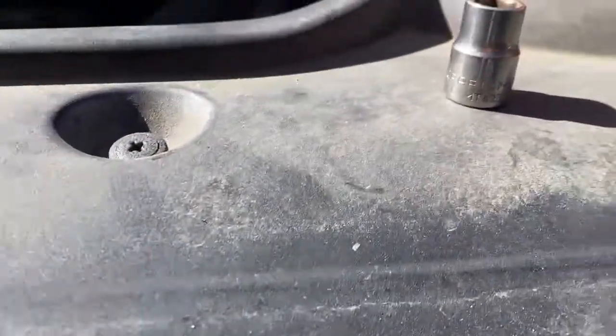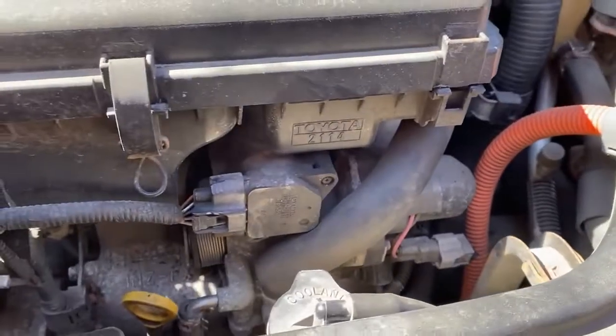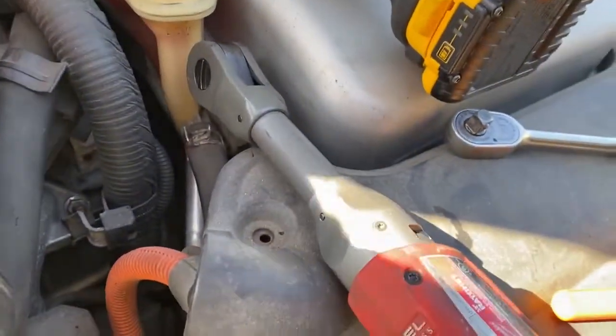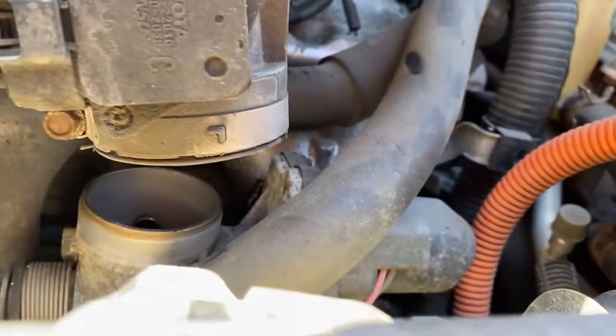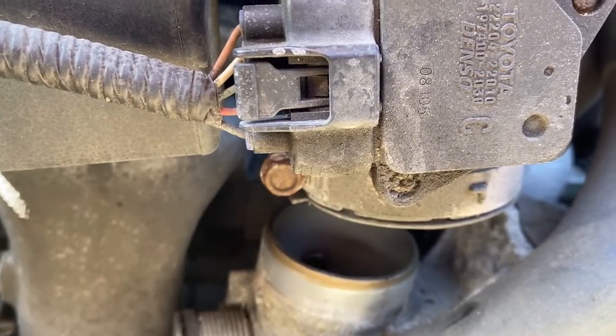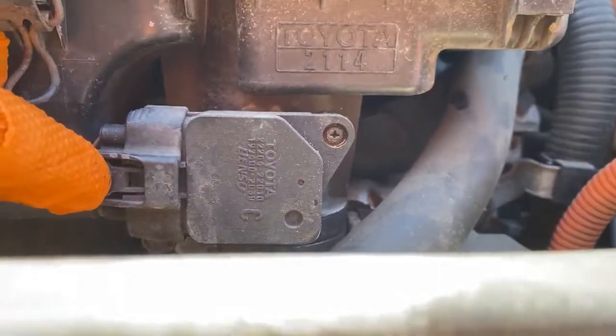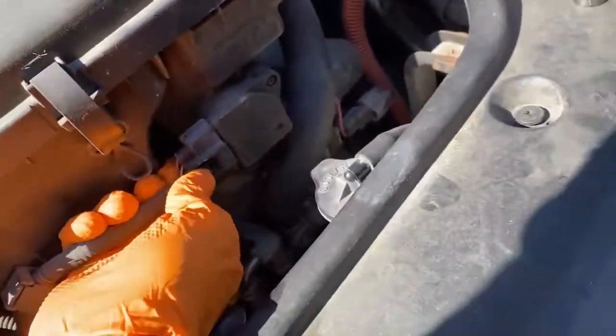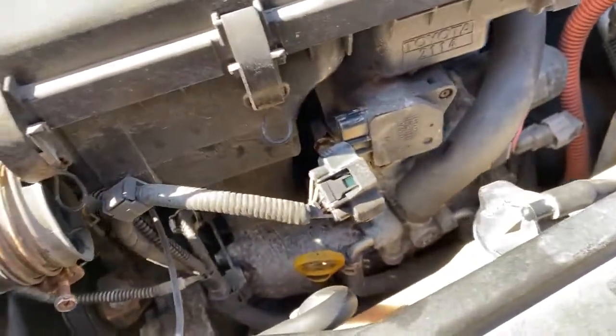And there is another one that I almost definitely won't be able to do on camera for you, and that is the hose clamp that is around the base that goes over the throttle body. Actually, never mind, because it looks like this one is already loose. Dead center of the screen is the nut that would loosen that if it was actually still tight, which it's not. You're not going to just go ahead and rip that off because we have to undo the mass airflow sensor harness, which I'm just going to grab. A little bit stuck. There's that.